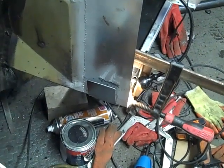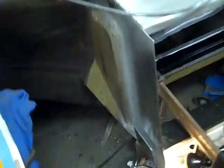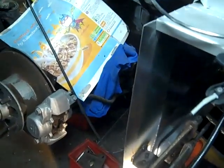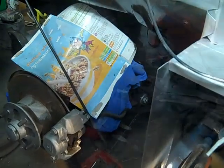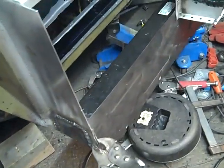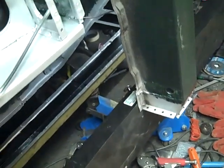So today we're looking at putting on the end of the castle section, and a few welds and straightening up of some of the welding around here, because the inner step sill is not actually bent as a right angle, so we've had to put several clamps on and attempt to straighten it best as we can, and then weld it on. So that end is now fully welded on, and what we've done is we've also put on, just temporary, a fit just to see if it's going to fit on, is the diaphragm part.